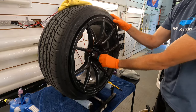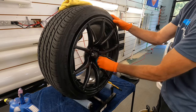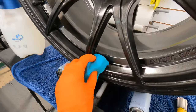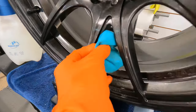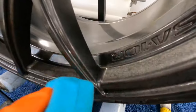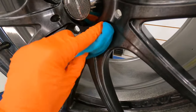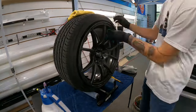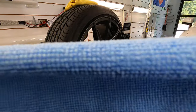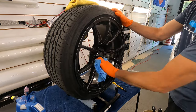Tip number seven: two coats minimum of the wheel coating. Wheels come in different shapes, sizes, and materials — from chrome to powder coat to OEM — and some of those materials can be very absorbent. As you can see, this applicator conforms to the shape of the wheel, so it works perfectly. This wheel has a carbon flash finish, but others come chrome, polished aluminum, clear coated, or powder coated. Do a minimum of two layers with two hours in between layers. If you have a 30ml vial and still have coating left, add more layers — that only helps extend the protection.